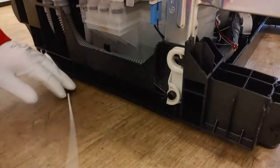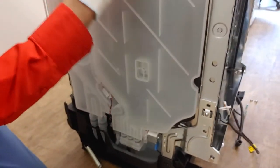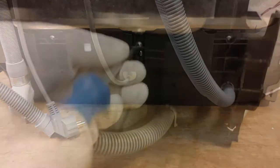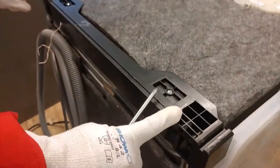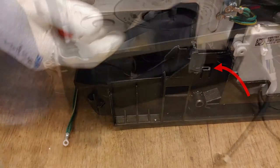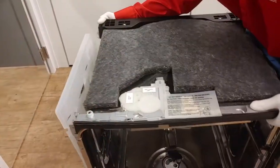Release the cable and the white clip on the other side. Remove two screws of the water and air guide, then unhook the water and air guide but leave the unit in. Be aware that this water and air guide is always filled with a few liters of water, and taking it out will cause an open flow of water. Remove two screws on the lower back part. Do not remove the top frame. Before taking off the cabinet from the base, check if the leg can freely move and isn't clipped. Remove the plastic part and check if the sump does not stick to the cabinet. Now take off the cabinet from the base.